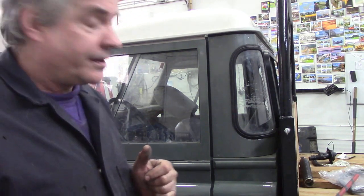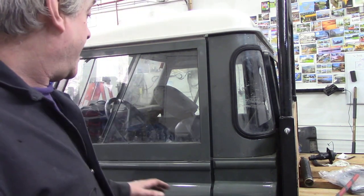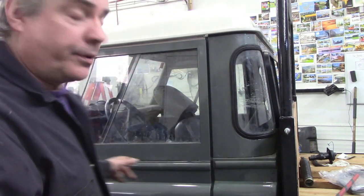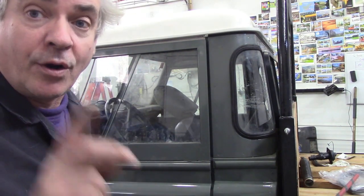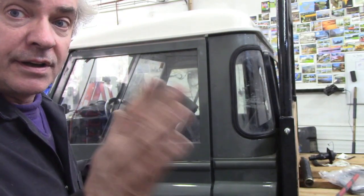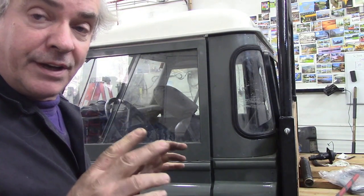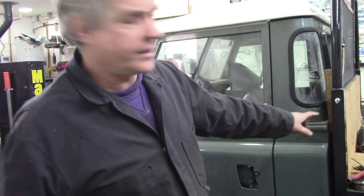So I think what I'm going to do is try to find a better place to put this camera for a start. Put a temporary block behind here, and then put the porta power and try and push that bulkhead forward just a hair with the door on, so I can shut the door and find out if the gap's right, because it might not need much at all.